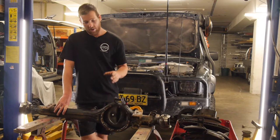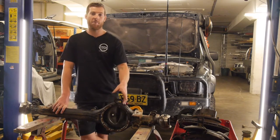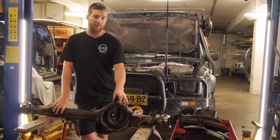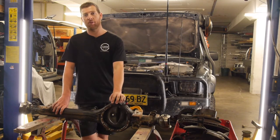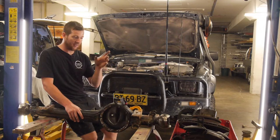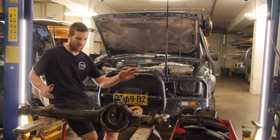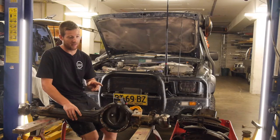In an ideal world I would probably go 80 series front and rear, which gives you a much wider wheel track — which is nice — but my rear end is working really well so I don't really want to rearrange all of that. There's also the cost perspective and the gear ratio perspective, because obviously the 80s don't come in a 4.55 or lower ratio, which I really need, especially with the 2.4. So I'm running 4.55 in this at the moment — that's one of the reasons I picked up this axle. I got it pretty cheap, complete with the same diff gears, and thankfully the gears are in salvageable condition so I won't have to buy gears. This complete axle cost me about 400 bucks. Big thanks to Dan down in Victoria — he was wrecking a 106, freighted it to me, and sent me a spare housing and other good stuff.